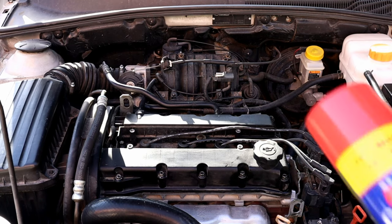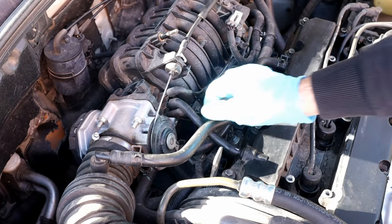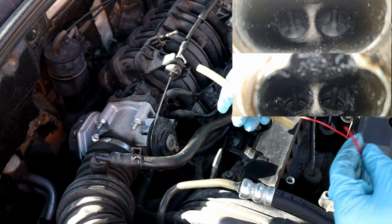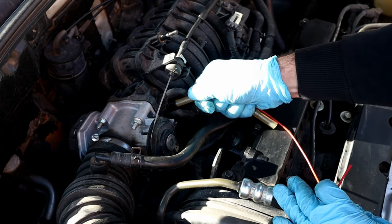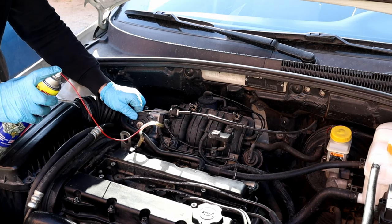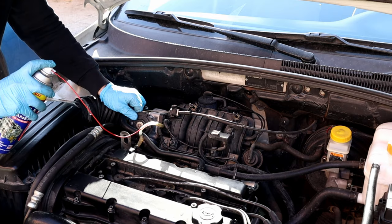For cleaning carbon buildup, I did a video where I sprayed carb cleaner from the same vacuum hose and had good results with it, and it also cleaned the intake valves. I will put the video in the description box below and YouTube card if you are interested to watch.